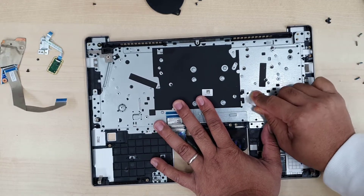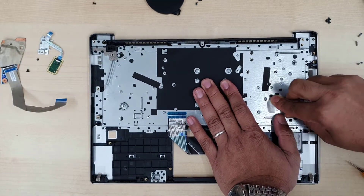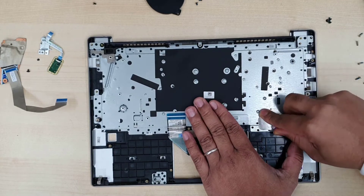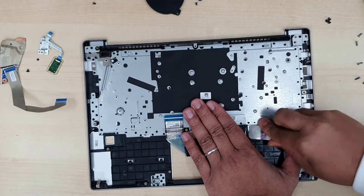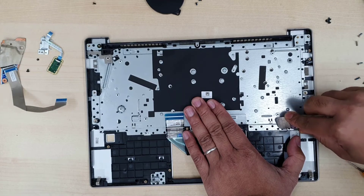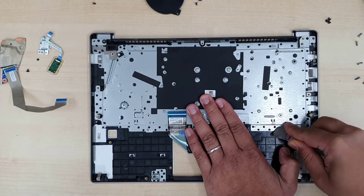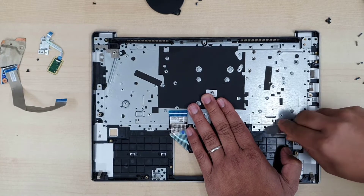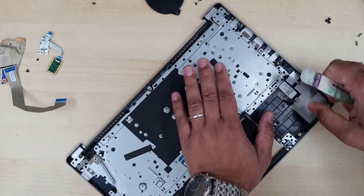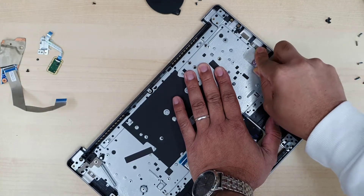Believe me, removing this is one of the hardest jobs time-wise. But if you have patience and try one by one, it will come out easily. This part took about 20 minutes for me and I tried many different tools. I used the iFixit spudger because it's flat and I can just rub it — it cuts the plastic bits, which makes it easy to pull out. I also tried a precision grinding tool but it was terrible — it didn't work. Try not to use any automatic or electronic tool to cut out these rivets.